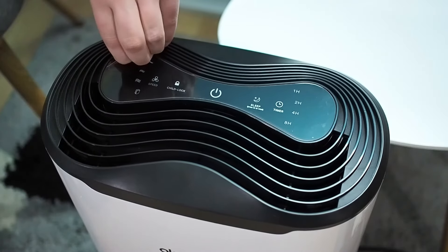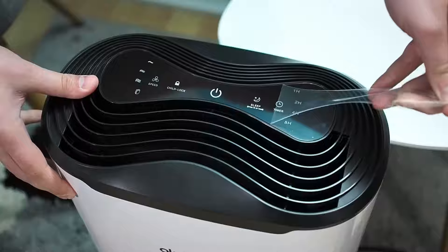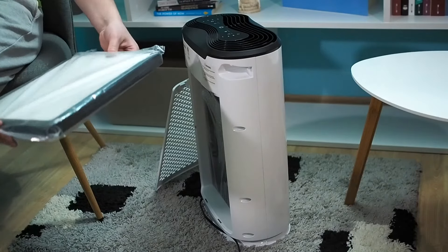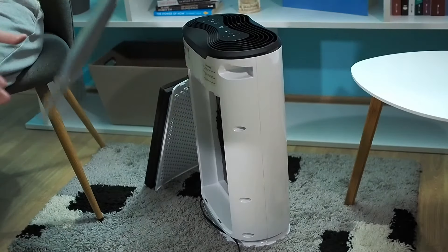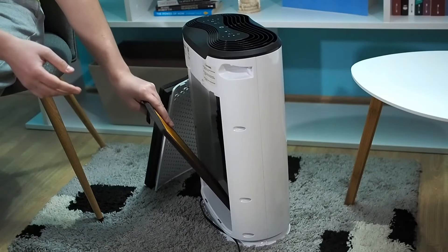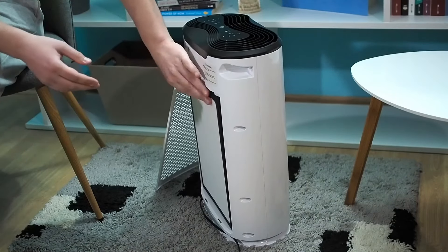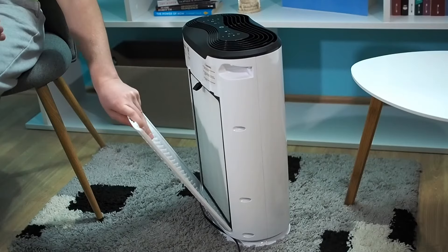The AirMax 8L is a bit more complex than the AirMic 4S. The first thing you need to do is take the air purifier out of the box and remove all protective plastic from it. After that, open the cover on the back side and take out the Ultra and Duo filter. Remove the protective packaging on the filters. Now you need to put the Duo filter back inside, and on top of the Duo filter goes an Ultra filter. As soon as the filters are correctly inside, close the backside cover.